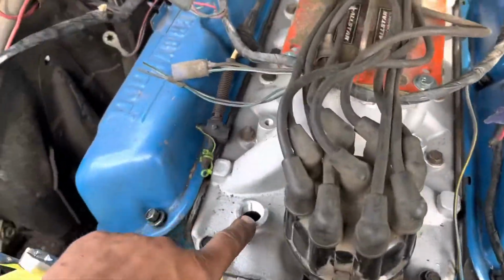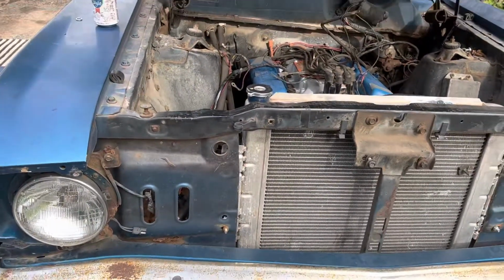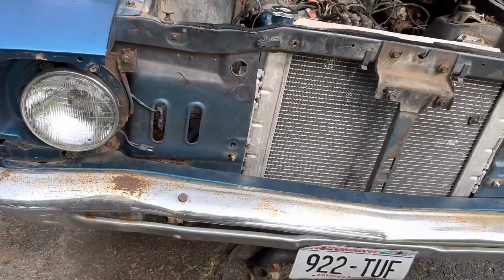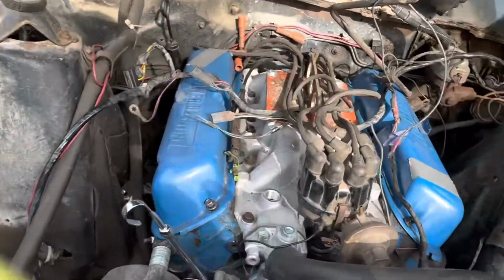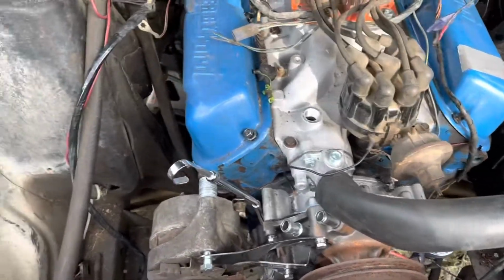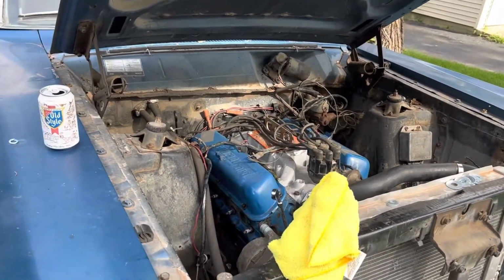I also put in another small order for the fittings and the coolant intake stuff to finish buttoning up the intake, as well as the carb studs and the carb gasket that I need. So ideally the goal for tonight is to, one, get the trans lines in. Obviously they're way shorter than they need to be, but at least get those in and pitched forward so I can route rubber hoses down through here and over. I don't have a trans cooler yet, but if I can get the trans lines in, fixed to the actual transmission going forward, the rubber line part goes pretty quick and easy. If I can get the trans lines in, button up the rest of the intake. Distributor still needs a quick rebuild, not that big of a deal, but if I can get the trans lines, intake manifold stuff, and the headers or the stock cast crappy manifolds bolted on for now, that would be a win in my book. So we're gonna start messing around with all of that and we'll be back.